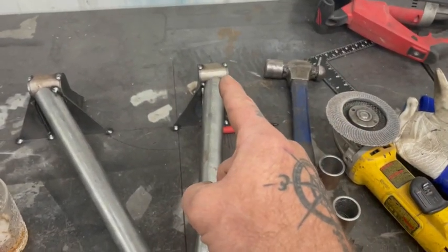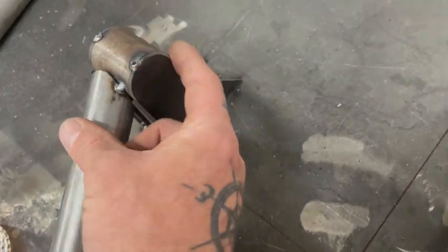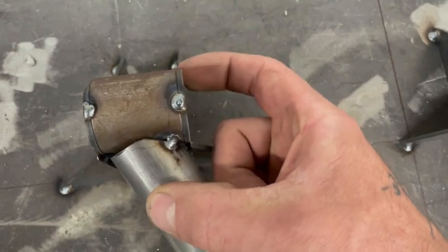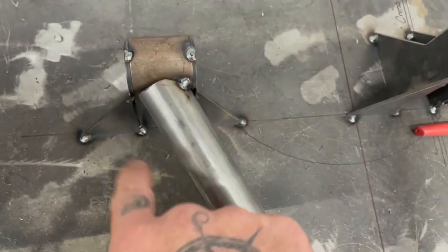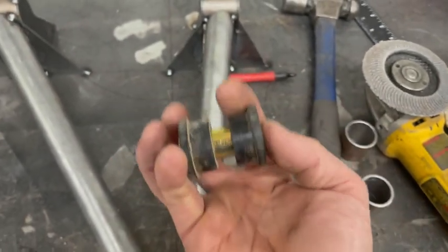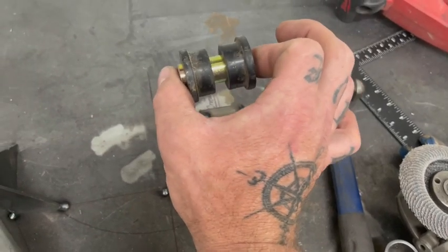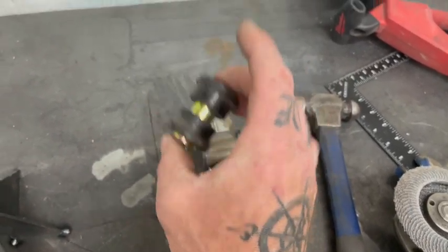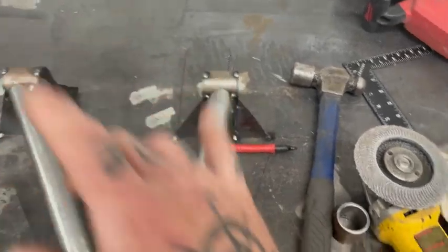If you are doing bushing, make your plates the exact size of your tube. It just makes it easier because you can tack them in there and you can weld this thing clear to death and you don't ever have to worry about melting this thing. There's a lot of people who'll build a jig, bushing in there, center off the bolt hole, yada yada. First couple welds, this thing's smoked and you're out of bushing. So, quick little tip.